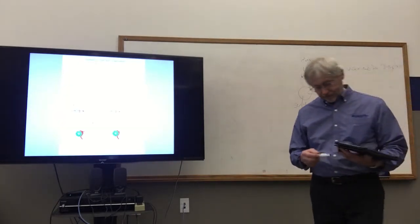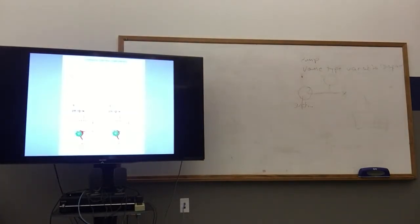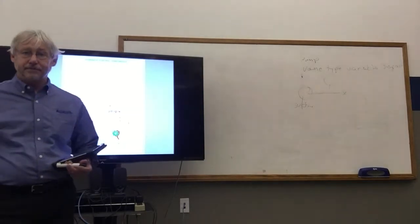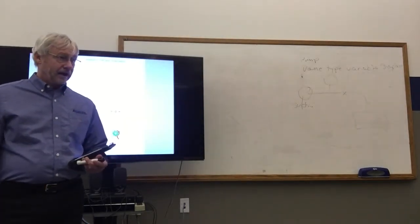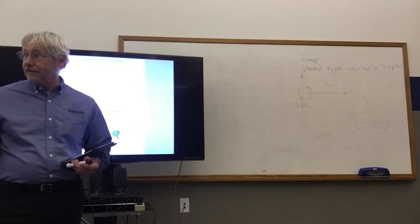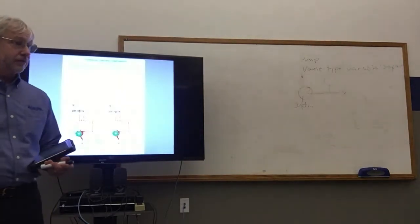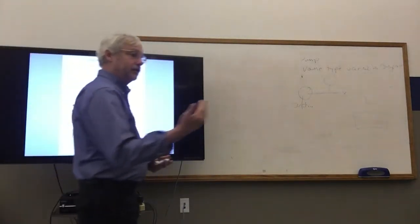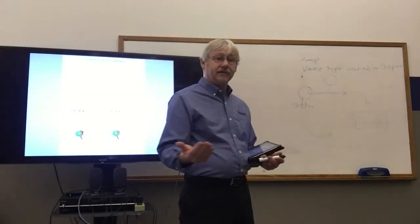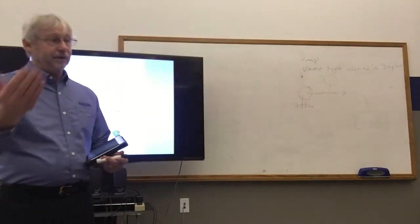So we can control the pressure by controlling the volume of fluid we're pumping — it's a variable displacement pump. We've got to figure out a way to control the displacement of the pump based on the needs of the vehicle, the driver, and the transmission. What we use to control the pump is a pressure control solenoid — a line pressure control solenoid — controlled by the TCM, or the TECM in this case, and we need some inputs.